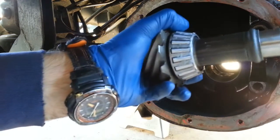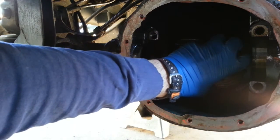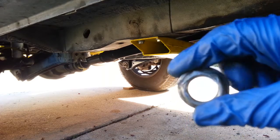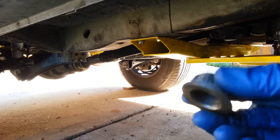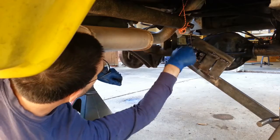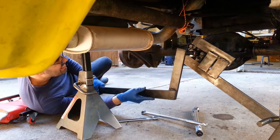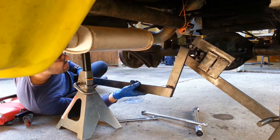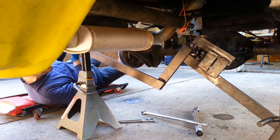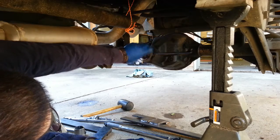Here's my pinion with some Vaseline on there. And yes, of course, there's the crush sleeve. Okay, so what I'm doing now is I've ground the threads at the top so this can screw on easily. This is the old nut, which obviously I'm going to throw away. This will enable me to do all my tests quite easily. Tighten it now enough so that I can feel a little bit of resistance.